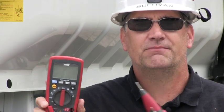The reason you have to be careful is because if you see a number on this meter, it means something is happening. If something's happening, somebody could be in the way of that something happening. I've worked and taught at some places where machinery is huge, and there's the lockout tagout rule, and the amp meter could play into the lockout tagout. It's not a meter that you just go in willy-nilly and use, okay?